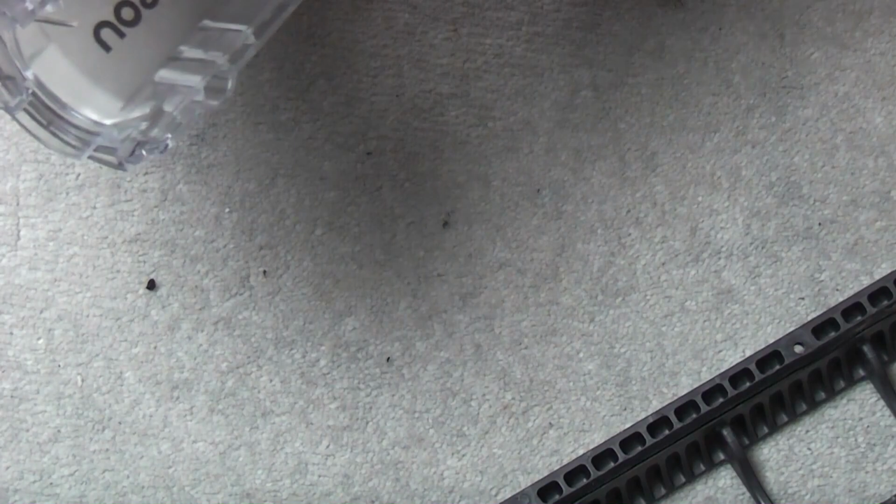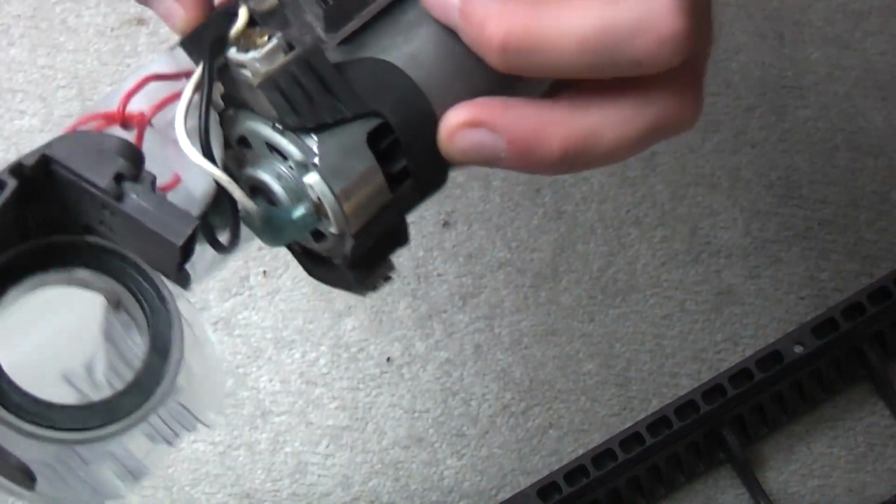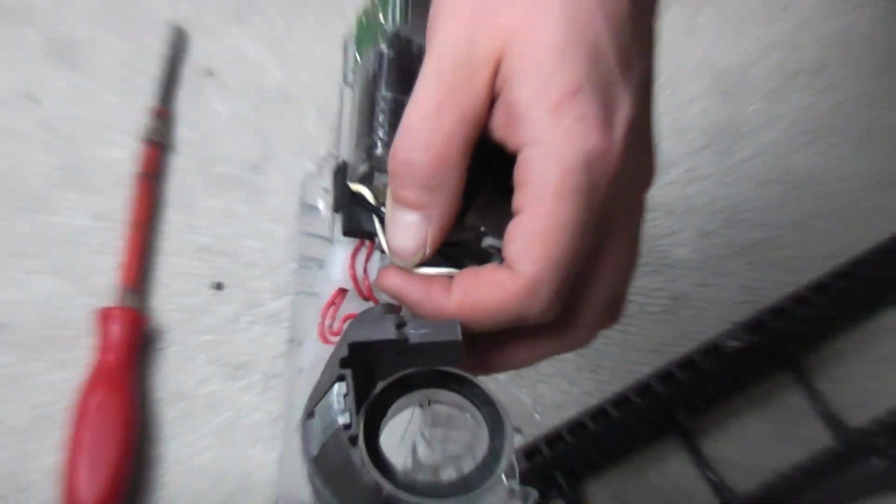Right, now we can fit the motor. Now this black rubber seal, there's a cable seal there, sits behind the housing, and you'll know it's sitting properly because it will clip home. Then the red wires carry on underneath it, and the black and white motor power wires push up onto the top, sort of underneath it like so, and it basically acts as a giant plug. There we go. Tuck those wires in just a little bit better. And there we go. Basically, that is all wired up.